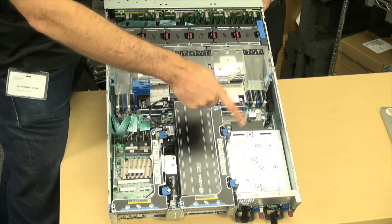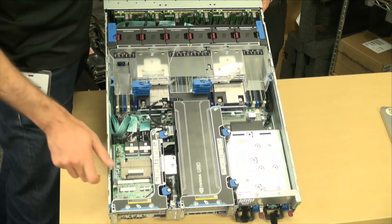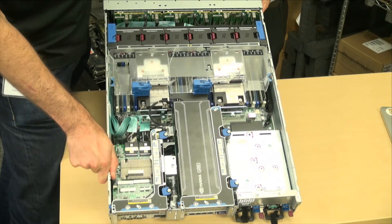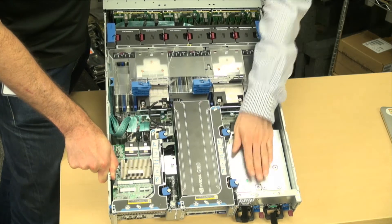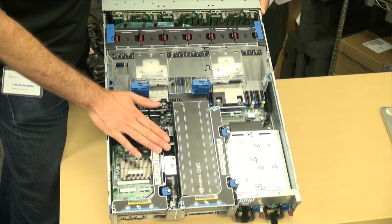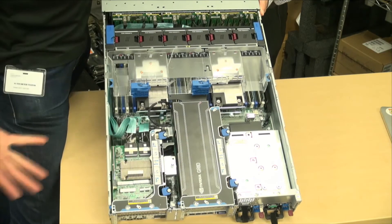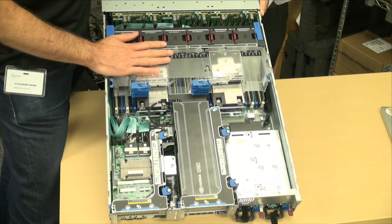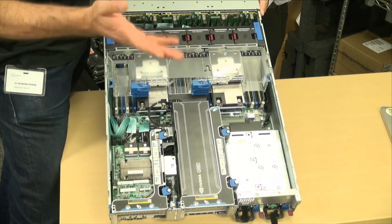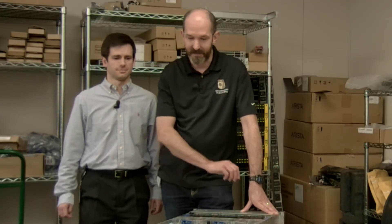There's a gap here at the back left that's got nothing in it, and knowing HP's engineering, that space is for something. Customers can order SSDs in there depending on the workload for caching and acceleration — this particular model doesn't have those, but that is something that could go in this spot. This is a commodity 2U chassis that HP produces, so it gets tasked with all kinds of different purposes. They're a nice workhorse piece of hardware — I remember them from the days of the G1 and G2 with a Compaq badge, and we're in an ex-Compaq office here, so it's nice to have a ProLiant here.